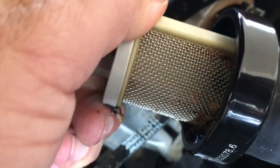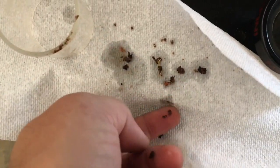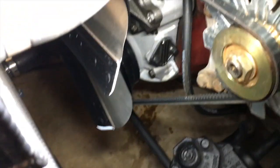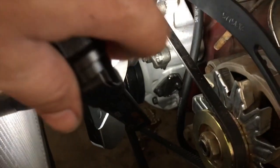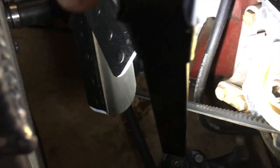That's what's coming out of the filter — I just removed it and took it apart. I'm going to remove the filter all the way and clean it out. For some reason it's not wanting to come off that end — it's just kind of stuck on, but I'll persuade it. So far so good — it's pretty dirty and getting a lot of gunk. No water leaks that weren't solved by tightening a clamp. I did have one oil leak at the manual fuel pump cover, so I'll need to make a new gasket for that.